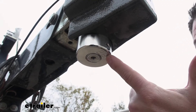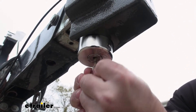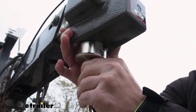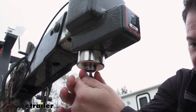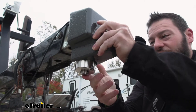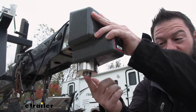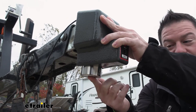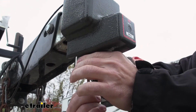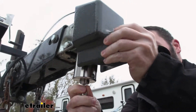Down here at the bottom we have a rotating disc tumbler lock and it's going to have a million different combinations. You get two keys with it. It's going to be resistant to drilling and picking just because of the way it's set up. You just turn the key a few times, then the button portion pops down to let you know it's disengaged. A nice thing is when you're setting up on the trailer, you don't need the keys — you can just push it back up into place and it's locked in. To undo it, use the key, turn it, this portion pops back down, and then you can remove the front.